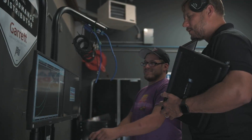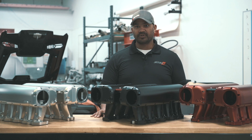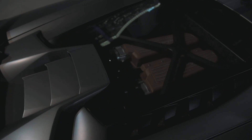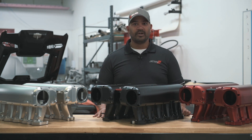The main focus was actually simply to hold pressure. The stock intake manifold geometrically was actually pretty good — the runner lengths were good, the shapes were good. A lot of work goes into the dual injection system on this car.